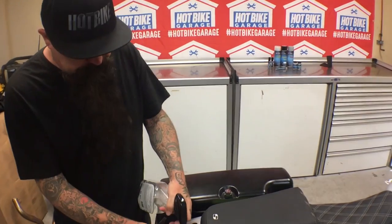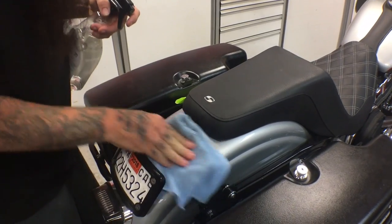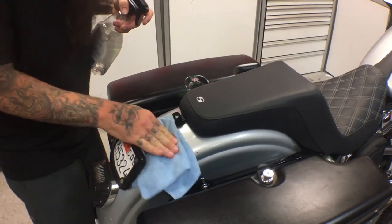We're going to hit it with the grease and wax remover one more time to make sure it's all clean. As I said before, the paint won't stick to an unstickable surface. You need to remember that with painting it's not the painting that's difficult but the preparation. You've got to make sure everything's clean, everything's flat on the surface, and that the paint will adhere.